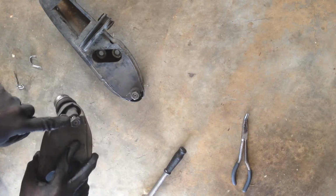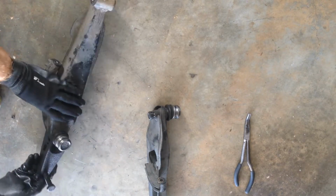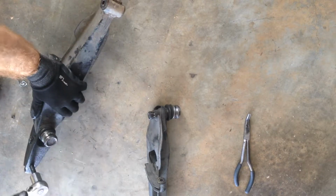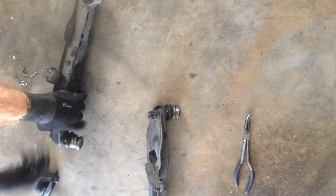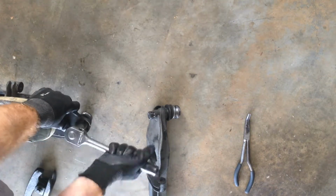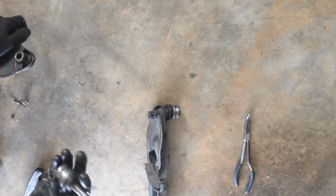Okay, like that. So we just turn the nut over and put the bottom level with the top of the ball joint thread. Then we put our ball joint remover on and apply some pressure. One's out. Now you've usually got to step on the arm to wedge the ball joint under the nut. Like that. Now comes the ball joint.